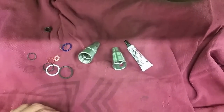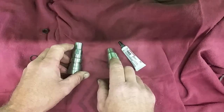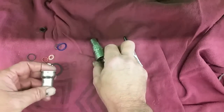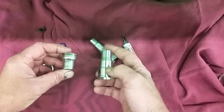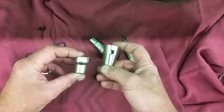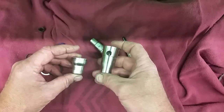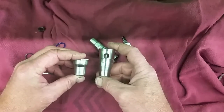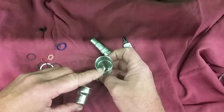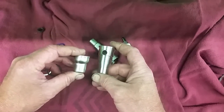When you get the kit — just the basic kit — you're going to get the seals that you need, a new injector tip, a sleeve for the bore, and some retaining compound. This is the cup that's normally inside the head. You're going to replace it with this one because normally when the head cracks, it cracks right above here. With this new liner, it's going to cover the crack, so the crack is no longer a problem because it's completely sealed up with this stainless steel liner. That way we don't have to worry about it and don't have to go to the expense of replacing the head.